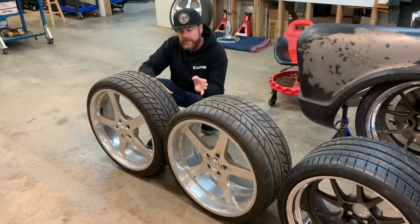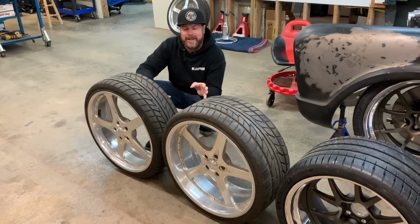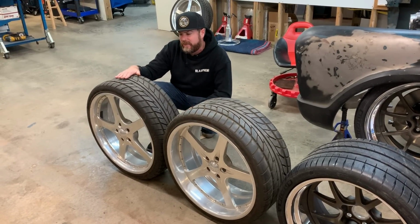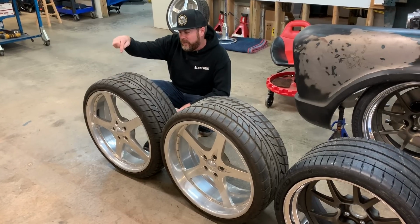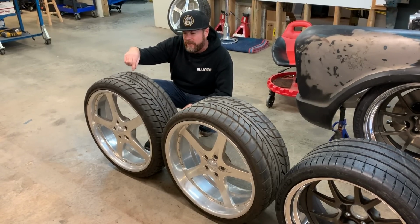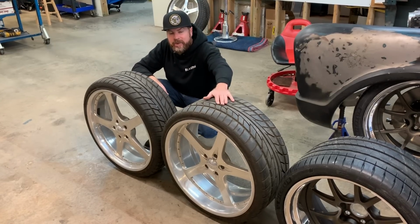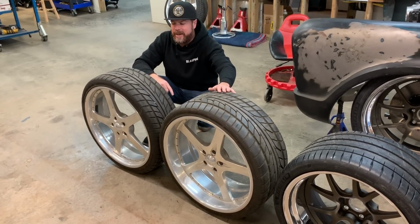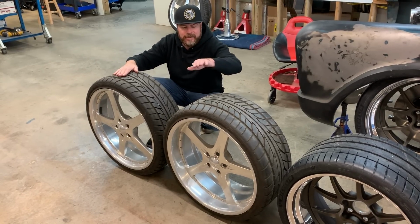Beautiful wheels, but when I ordered them, we just kind of ballparked what we thought we needed, and what we ended up with were 22-inch wheels, 10s in the back, 8.5s in the front, but at the time, the only tires we could get to fit were these Nitto Extreme 555s. This is a 255/30/22, which oddly enough is a half inch taller than the rear tires, a 295/25/22. Rubber bands, and yeah, that's a weird stagger. Half inch taller tires in the front than the back.